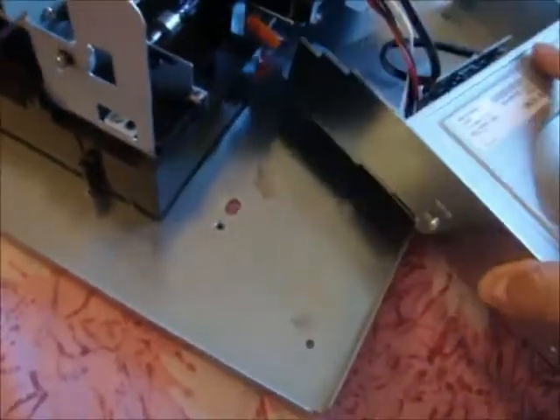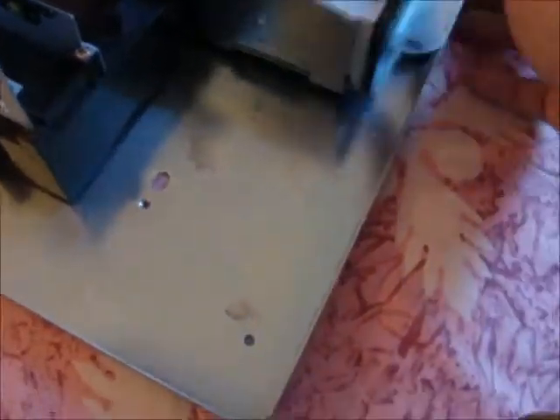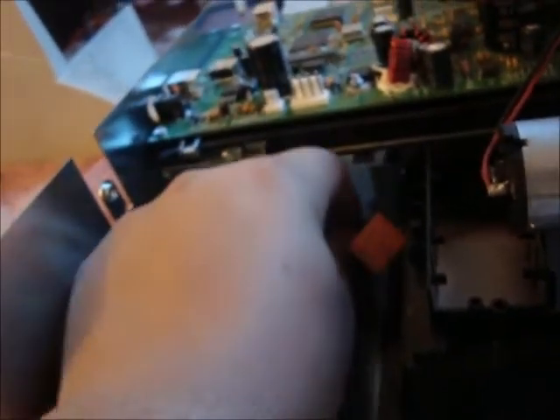Putting it back together. These cords, feed them in here. This doesn't have to be perfect, just get it in there. It's a lot easier when you have two hands, so if it looks like I'm struggling, I am, but don't worry, it's not that bad. Down here, you're going to have to take these two cords — the USB and the power Molex connectors — and pull them out, so that way when you push the drive back, they don't get crumpled and pinched in the back here.